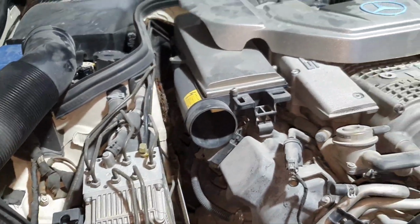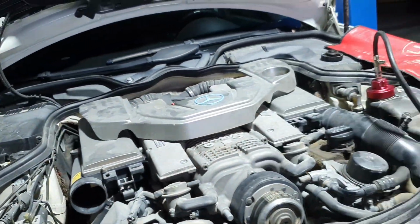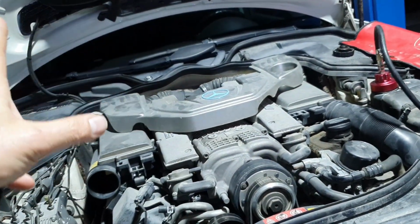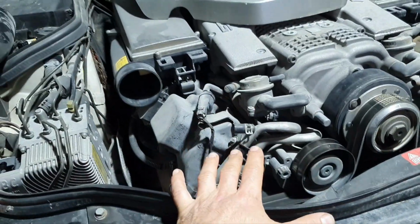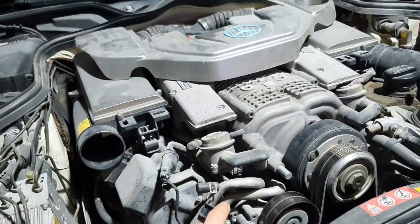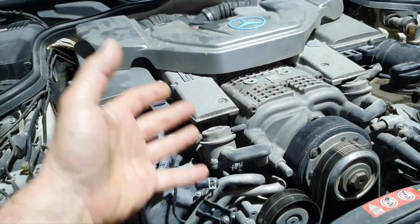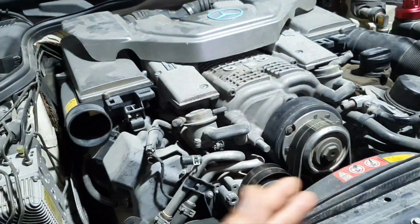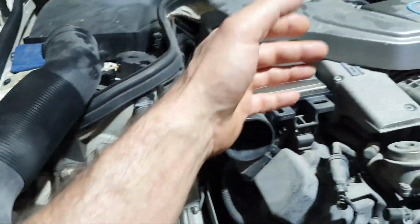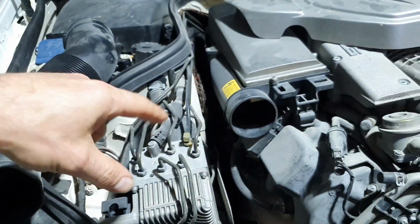Then, another three things that I want to check. One is the auxiliary battery. The other one is the main battery back. And then fuel filter and fuel pump, the center unit back, to see if there is any leak. Again, we're talking about a 16 years old car. We're talking about 200,000 kilometers, almost. You're not saying that, aha, okay, you're going to be fine. Nope. Like I said, you're not guessing. You're checking. You're testing, and then you get your conclusions. I hope that I make myself clear. And when you're closing, when you're blocking the heater core pipe, do not block it. Just loop it. Fine.